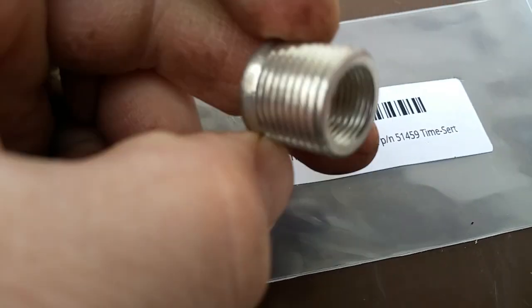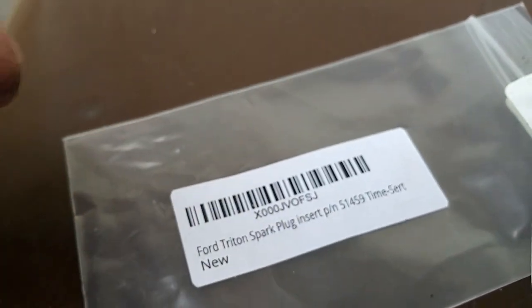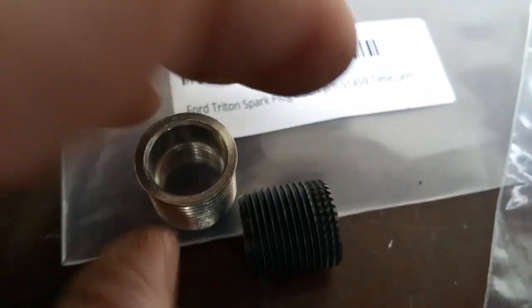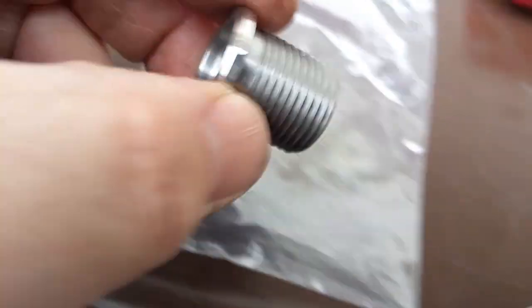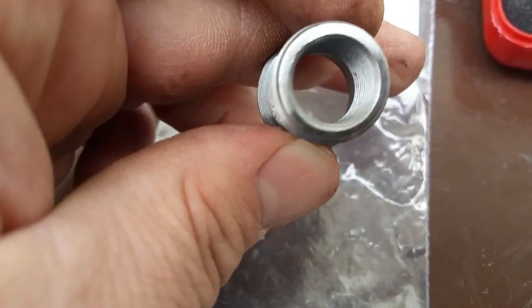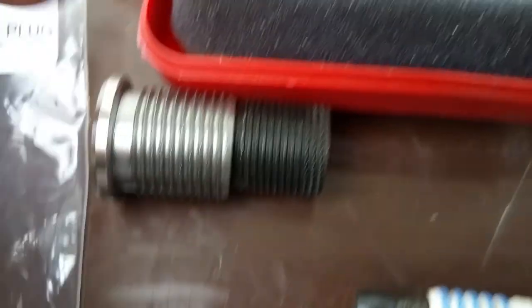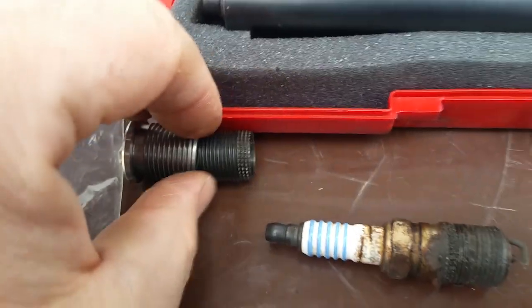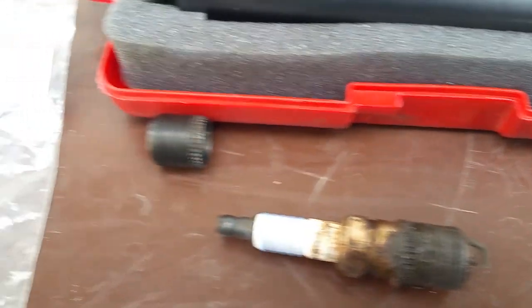I kind of like the TimeSert, but unfortunately if I were to redo the head I don't think I'd use it at this point because I've already opened it up. The CTA and TimeSert diameters are similar but not the same — the TimeSert is slightly larger, so I couldn't use the re-threading tool to put it in. If you made a mistake, I'd feel comfortable going with the Mountain MTN 9201 — there's enough room, and you can see the difference in diameter laying them next to each other. I hope this review guides you in your choice among these three repair options.